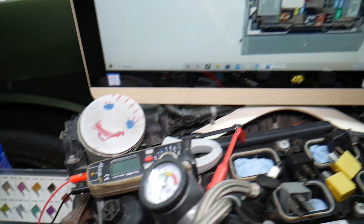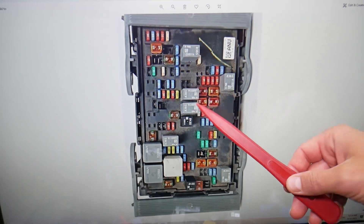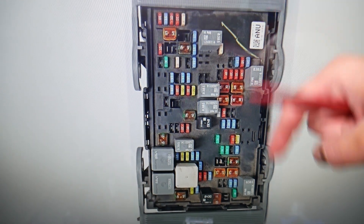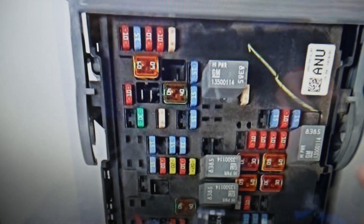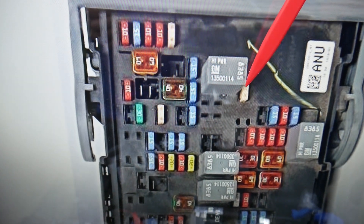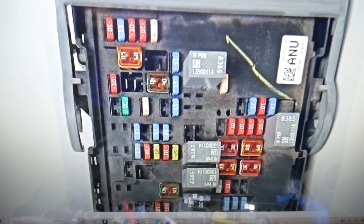The wiper fuse is a little hidden. If you zoom in and come toward the rear section of the fuse box, you'll find fuse number 36, which is a 25-amp fuse — that's the wiper fuse, right next to that relay. It's a bit out of the way, which is why most people ignore checking that fuse. By the way, if you need to buy fuses, relays, or parts for your Chevy Tahoe or Suburban, the link is in the description below.